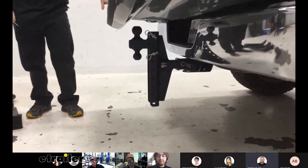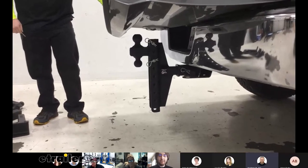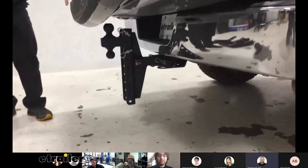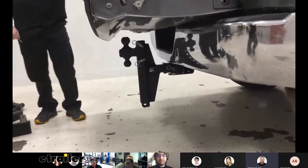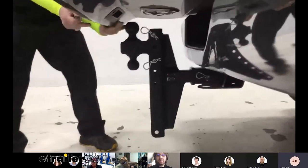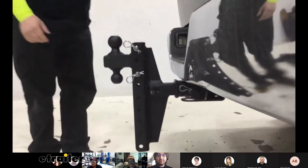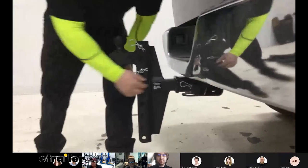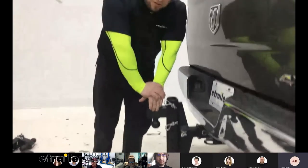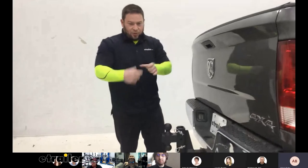With a hitch like this, you're probably going to have a truck that's a little bit higher — these type of hitches are more for a lifted truck where you have to drop more than rise. The gusset is pretty close to the bumper, but it's got about three inches of clearance, even in the rise. They did note it might interfere with rock tamers — if you go put rock tamers around there, there might not be enough space for the collar to fit.